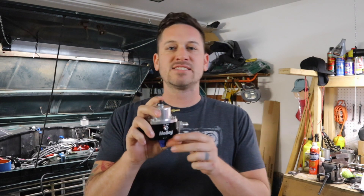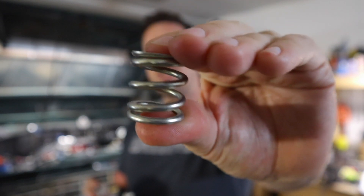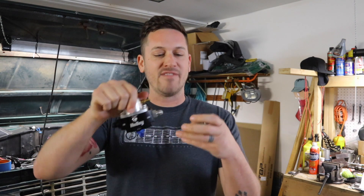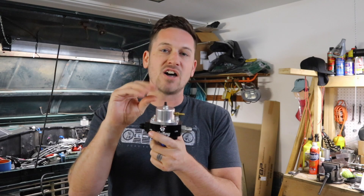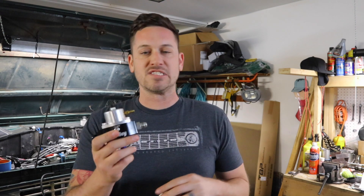When you're looking at a fuel pressure regulator, there are a few things that differentiate them. One is carbureted versus EFI, and the main thing with that is the spring inside here. This is the EFI spring — it's pretty tough. The carbureted spring comes already installed. So I'm going to swap it out and put the EFI spring in. Basically, this regulates fuel pressure based on vacuum from your engine. A stiffer spring is needed for EFI because you're dealing with higher PSI, versus a softer spring with a carbureted system because you're dealing with a lot less pressure. So make sure if you're buying one of these, you get an EFI system versus a carbureted system if you're running EFI.